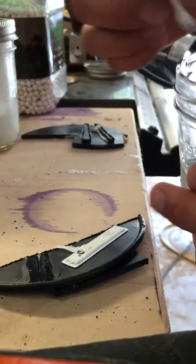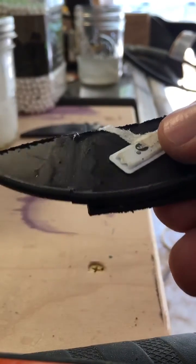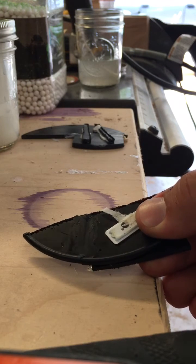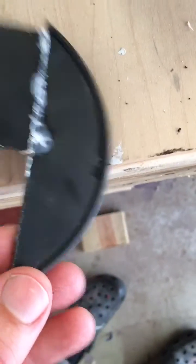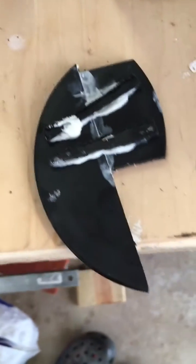That's pretty well wetted up and it actually did a decent job of filling the top side of that crack. It definitely got rid of the sharp edges. Here's the piece we glued up with the ABS homemade resin and stitching — you can see it's pretty solid, and it's only been drying for about half an hour. So that's what you can do; you could clean that edge up if you wanted to make it pretty. I hope this video helped you out if you're in the same boat, and good luck to you.